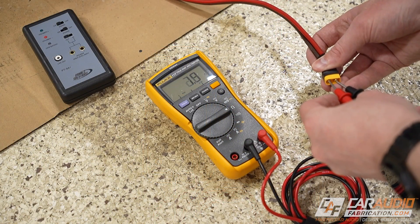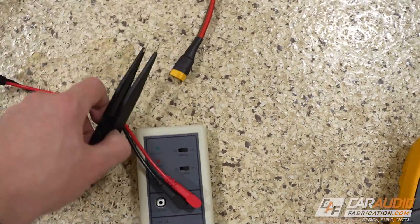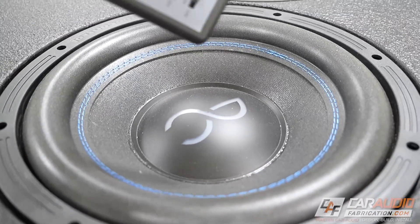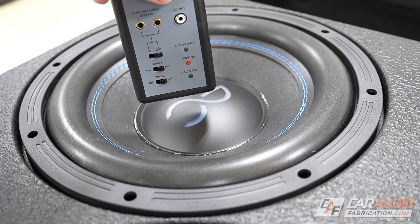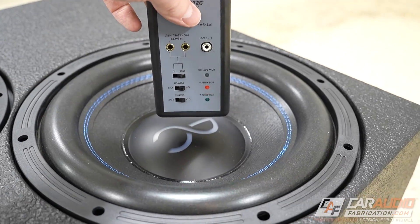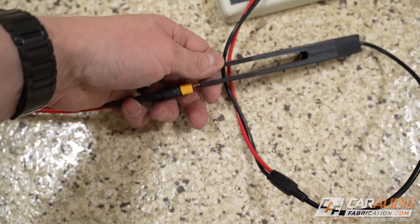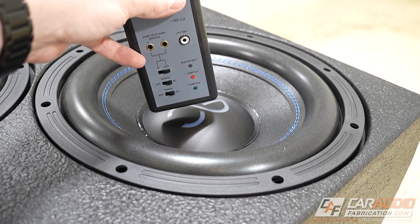Good to go on this side, good to go here. It also can't hurt to make sure that all of our subwoofer polarities are correct, so we're going to use a polarity test tool along with a probe. Let's turn this on and we should hear a popping noise — it might be hard to hear because it's pretty faint. We got green polarity there and green polarity there. Let's check our other bank — green polarity there and there. Just a quick simulation to show that this does in fact work: I'm going to flip the probes around and you can see if one of our subwoofers was wired with opposite polarity, we would get that opposing red color.